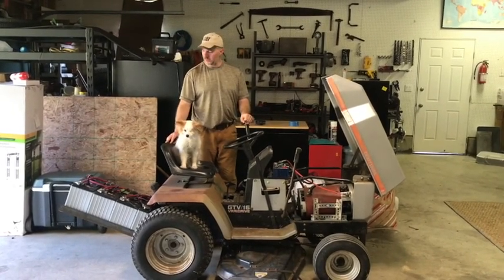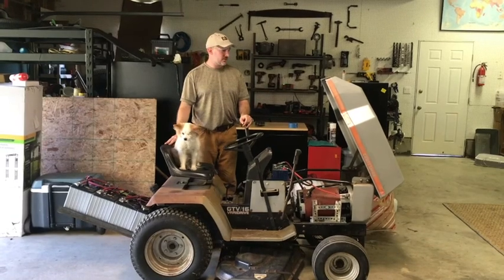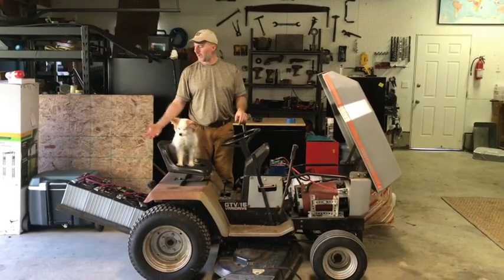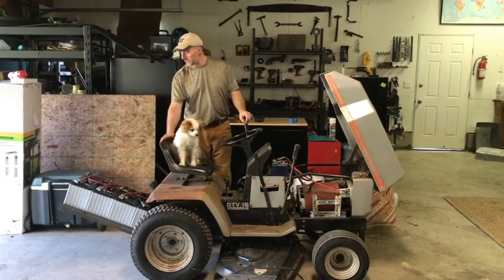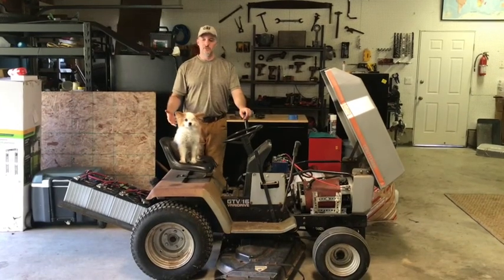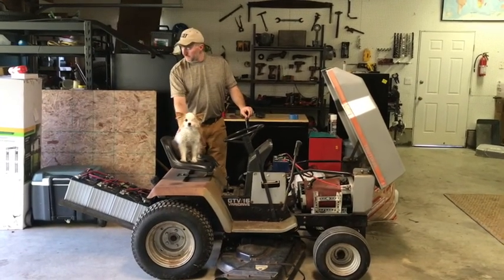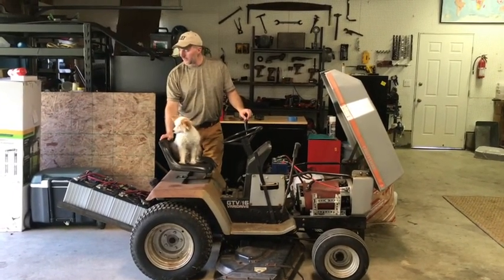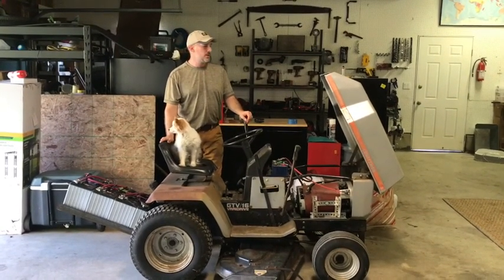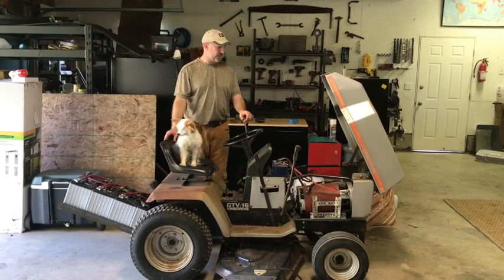Be that as it may, I've enjoyed this project. Pros of it: very low noise. I haven't done a lithium-ion battery pack — these are glass mat batteries, and they weigh a bit back here on the rear axle. But it being a Garden Tractor with a very strong rear axle, this has a phenomenal ability to climb slopes both up and down, so I've been really happy with that.